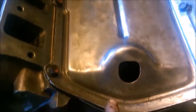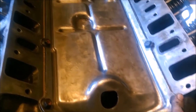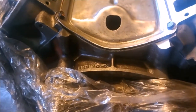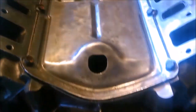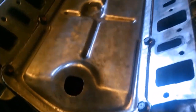Put a microfilm — as small as we can smear — on the gasket side that touches the pan, stick it to the pan center. The only place I'm using thread lock where it was not recommended is here — it'll help seal those through-holes and keep it in place since we can't get at these later. I ended up going around once tightened and very lightly tapping the edges so everything was straight again. This pan was already distorted and somebody already hammered on it. I also wiped it clean with lacquer thinner first, and the underside I smeared with oil everywhere but the mating surface to keep it protected.